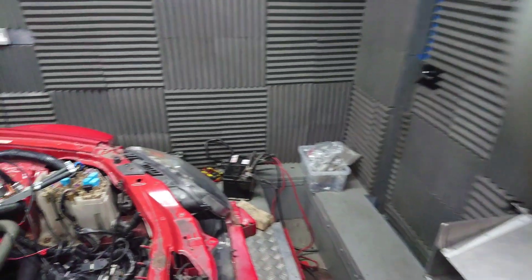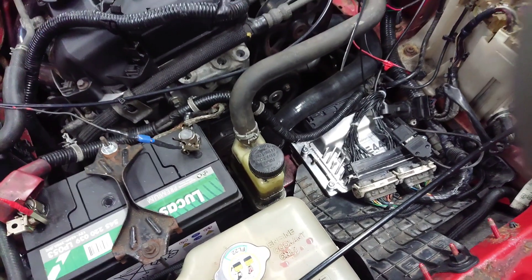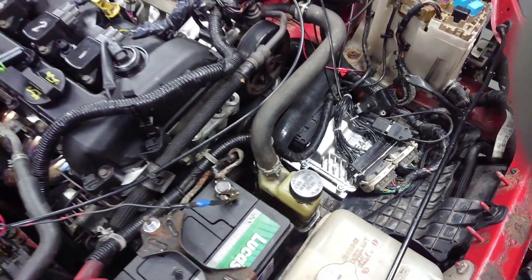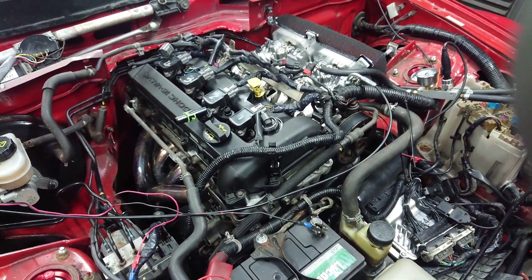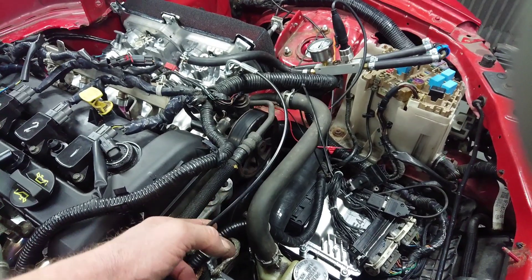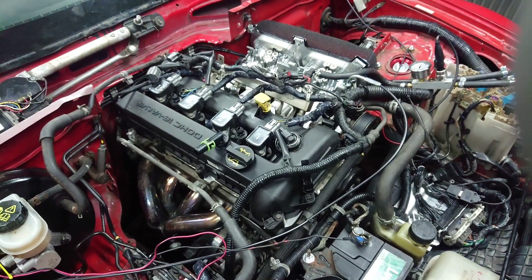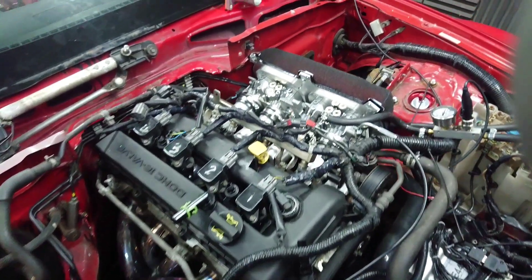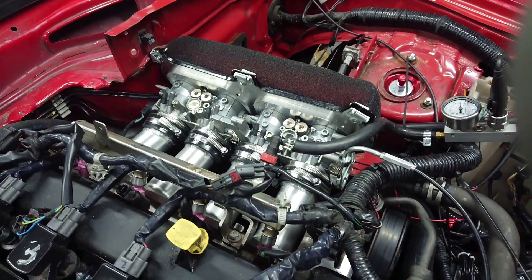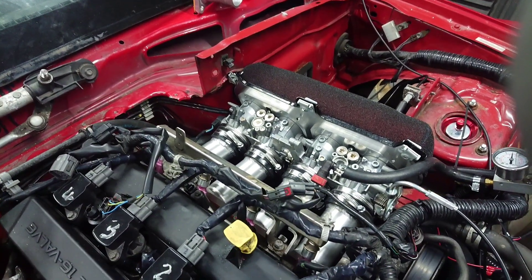Aside from that I'm still very pleased with the result. We're using the ME442 ECU for full control and all the motorsport features that go with it — it's plug-and-play with a little patch harness as you can see. A few notes about the install: we've converted to a cable throttle, as you can see, the pedal has been adapted and that's pretty straightforward. We can provide details on how to do that. These are 48mm throttle bodies for the 2.5 litre; we're going to offer them in 44mm for the 2.0 litre, along with that short manifold for the left-hand drive version.